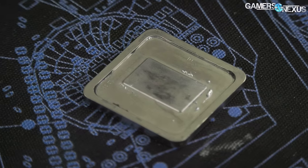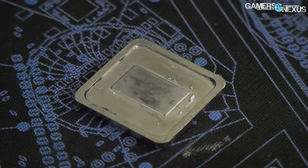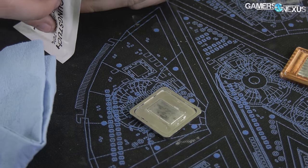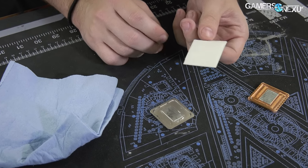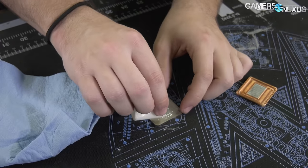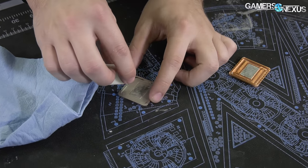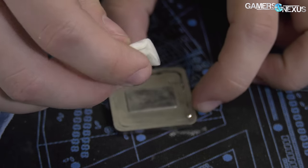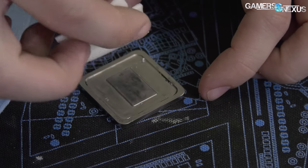You can also buy cleaning kits — this one comes with the CoolLabs solution — but it's overkill. You don't need this stuff. It's basically just 70% rubbing alcohol pre-applied, the same thing we just used. You'll see it still pushes the liquid metal around, and that's where Q-tips come in. Otherwise it should just pick up and more or less disintegrate a lot of the liquid metal you see.